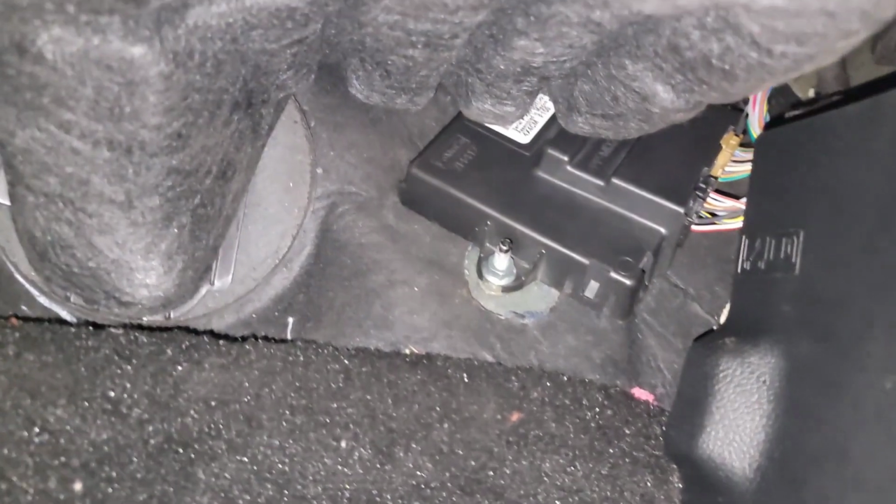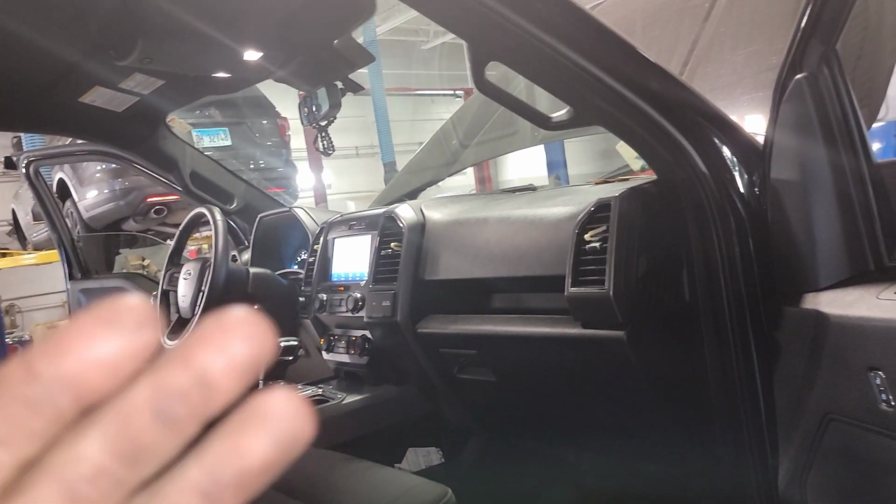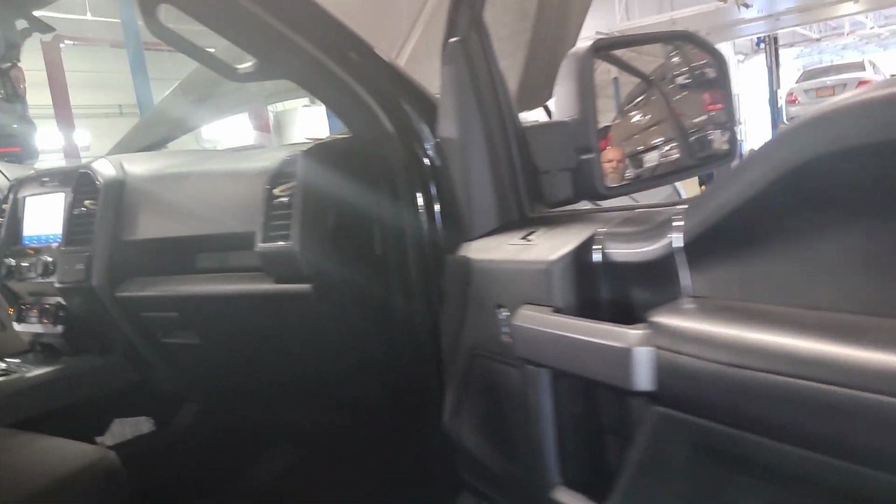You need to drive the vehicle for at least a half mile every single key cycle before you will get two-wheel drive. It's stuck at four-wheel drive for the first half mile until it builds up sufficient vacuum to properly release the IWEs, to properly vacuum pull away the IWE engagement from the back of your wheel bearing. That drives the CV axle, because the CV axle is splined to the wheel bearing. The wheel bearing has a spline on the back of it that engages with the IWE, which is controlled by the solenoid via the TCCM in the footwell over here. It's a flat panel down on the ground. And driver control. You need to drive a half mile before you can even check for proper power and ground.